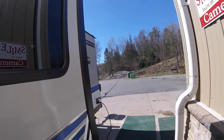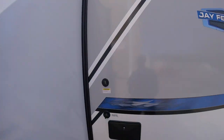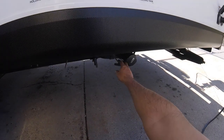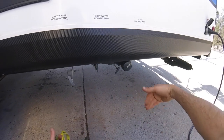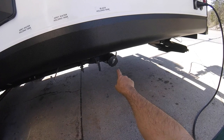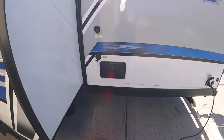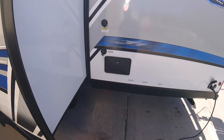Going around back, you have your flush valve here. When you're draining your system, you hook the hose up to there. Make sure your drain system is open — you have your black tank and gray tanks; pull those to allow everything to drain. There's also your connection for your sewer pipe. You have your city water connection, where you can hook up a garden hose and run water inside just like at home when you're at a campground.